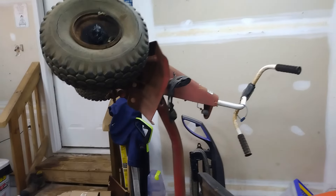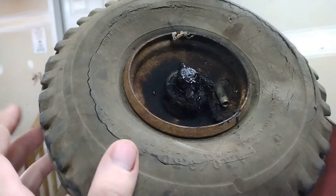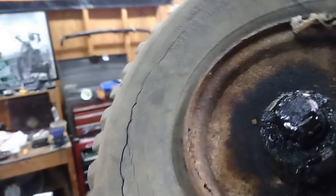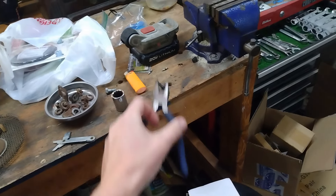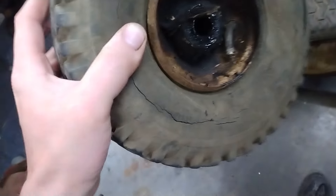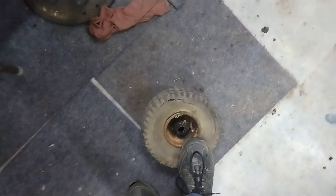Okay, now that we've dealt with some other stuff, let's get these wheels off and change these tires. For the front you just got this little cotter pin right here, pull that out and the wheel comes right off. Dirty as anything - I'm going to clean it with brake cleaner first and clean it all off. The dust shield right there fell off. The bearings don't look too bad, didn't have a whole lot of rattle on them, but we're going to clean up, wire wheel, and then repaint these wheels the white they're supposed to be. I took the valve cores out to let any additional air out so we can easily break the bead.